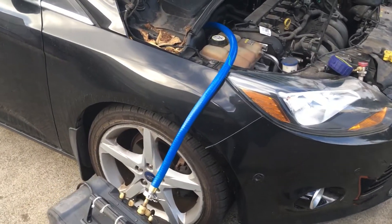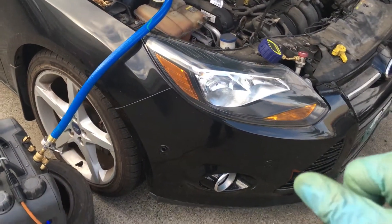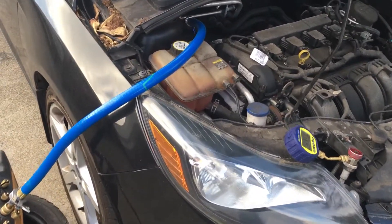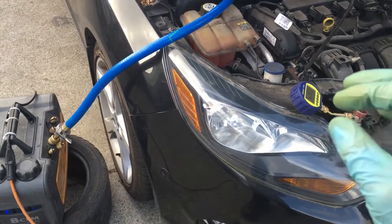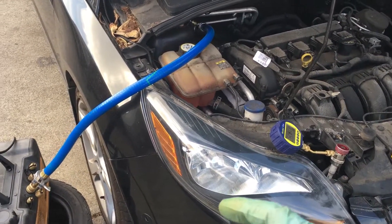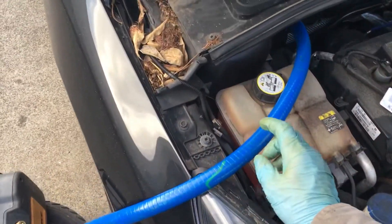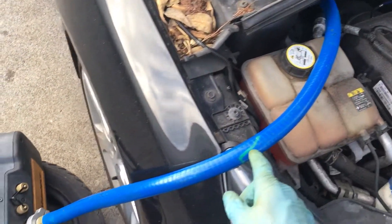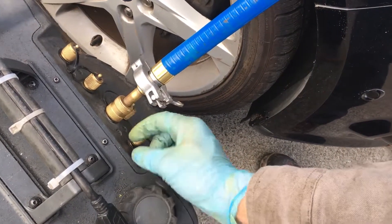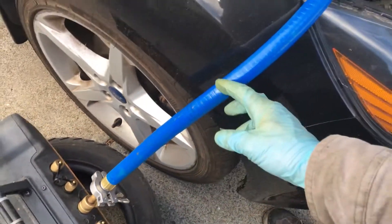Air conditioning on a Ford Focus using a single-hose method. I've shown this a few times before, but it's been long enough for newer subscribers to see it. In this situation, one single silicone hose, three-quarter inches, going to a large diameter three-eighths inch opening instead of the little tiny quarter-inch opening you're normally used to with your gauges.